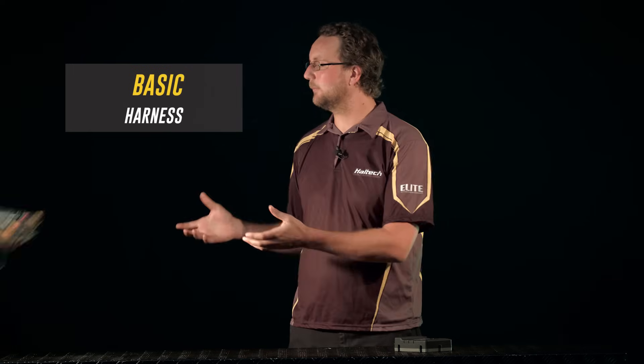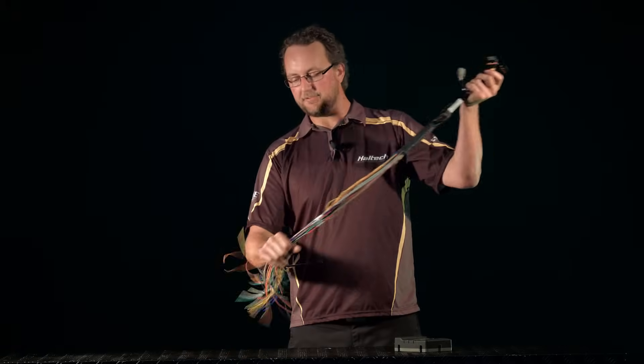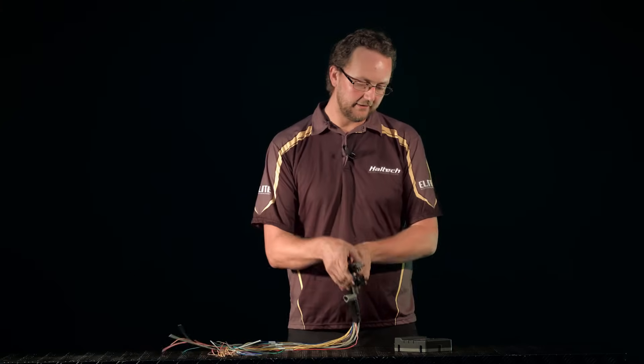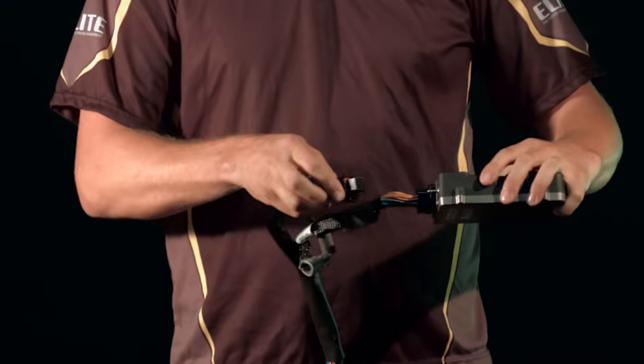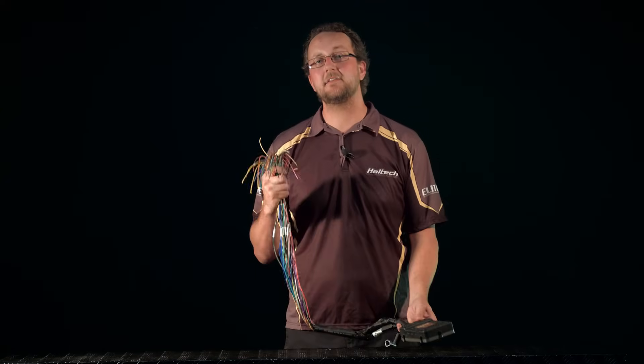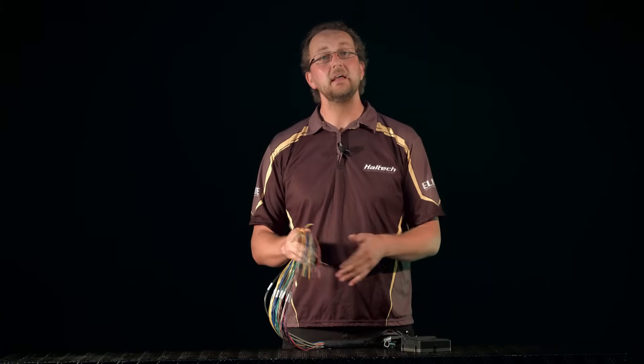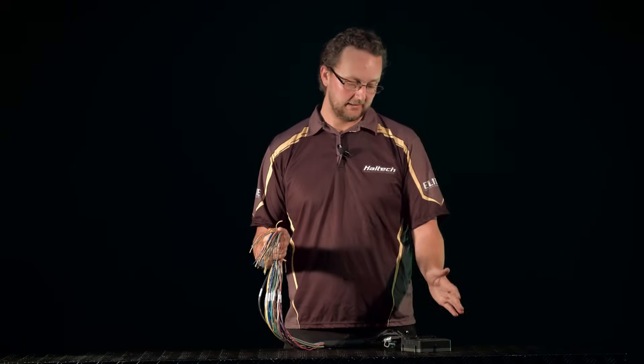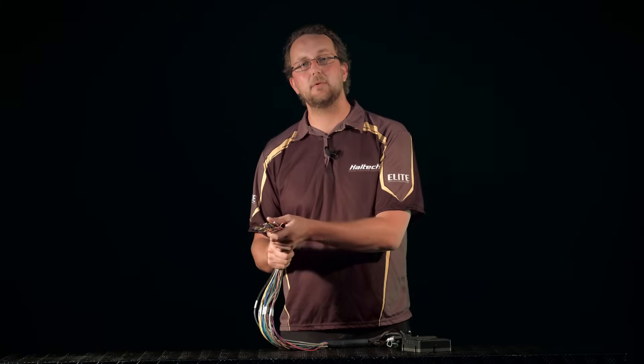The next option is a piggyback style installation using our basic wiring harness. The basic wiring harness comes unterminated at one end — it's about 1.2 meters long — with all wires open on one end and terminated into our Elite connectors on the other. From there we wire the short harness into the car's factory wiring harness. You can do a piggyback style installation which leaves the factory computer in the car to control things like the tacho, dashboard, and other factory functions. On our end we wire our fuel injectors, ignition, power supplies, and sensors, get them set up in the ECU, and get the car started and running.